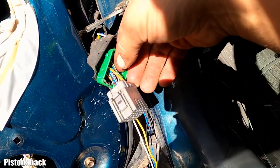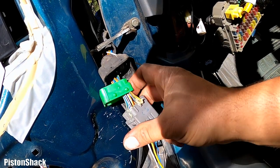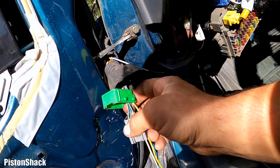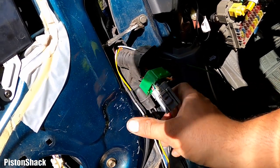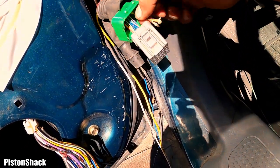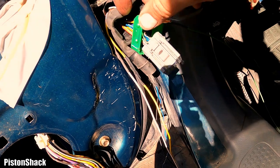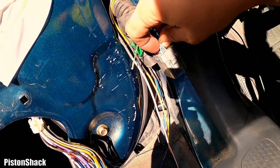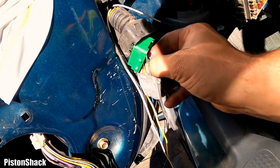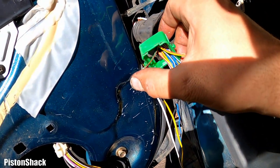And what I noticed, I got 5 fixed, but this is another one came off. This is another one came off too, and yeah, not good. And I have a feeling that we probably have to chop this thing off and wire it maybe directly, because I have 2 more wires to fix. This one's not good, and it feels like, oh, here's more wires, or kind of break it off. Yeah, some of them are still intact, but who knows when they will come out. But yeah, we have 2 more to fix. A yellow with a red tracer and green skinny with a red tracer.